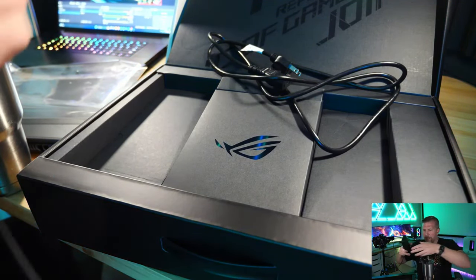All right, and I want to point out that right now, the wrist rest is getting a little bit warm, and the WASD keys are also getting a bit warm. It's not as hot as what the Blade 16 was, but it's definitely on the warm side. Here we go. We're on full HD plus now, 16 by 10, so the native resolution of the display. And right now, we are CPU bottlenecked, it appears. It's pretty incredible that a system this thin and light is doing 165 watts right now through the system. It's pretty nuts for a thin and light laptop. Normally, you're seeing more like 120 or 130 watts through a system like this. So we are getting very high CPU temps overall, but the performance is surprisingly good.